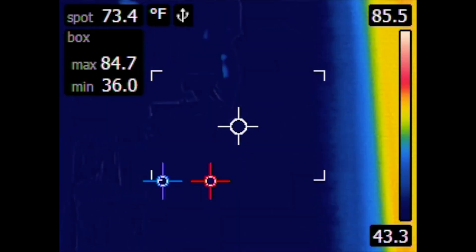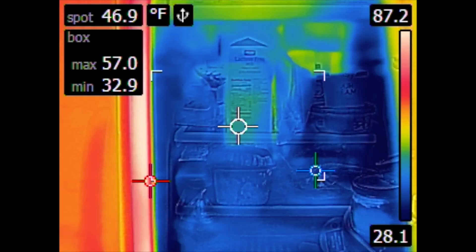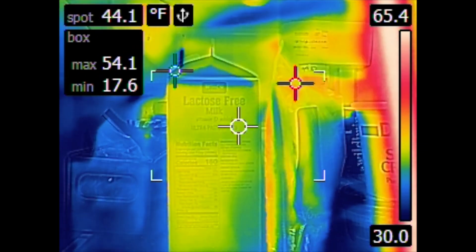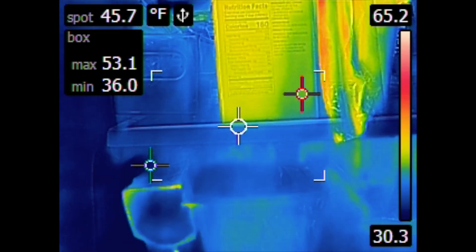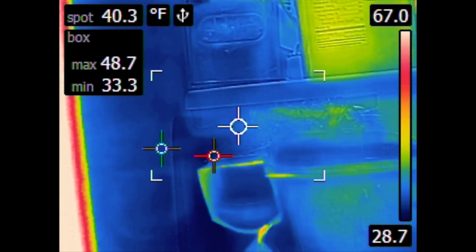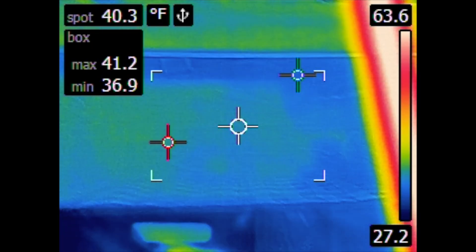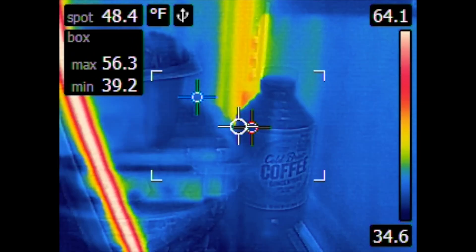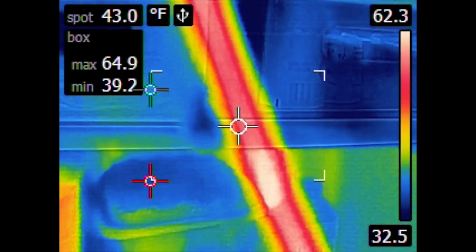On the right-hand side, the fresh fruit compartment - I'm not going to pay attention to the max reading at all. What I'm looking for is the min and the spot readings. If I'm in the 20s, 30s, or 40s, then we're looking good. The imager is taking readings from a lot of different places, and you want to get an overall grasp of the temperature. It's just a tool you have to get used to and get comfortable with.